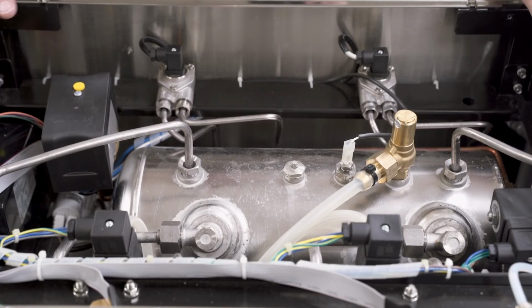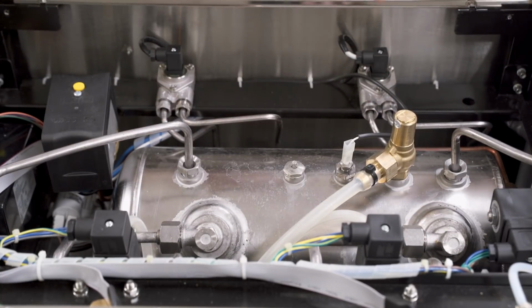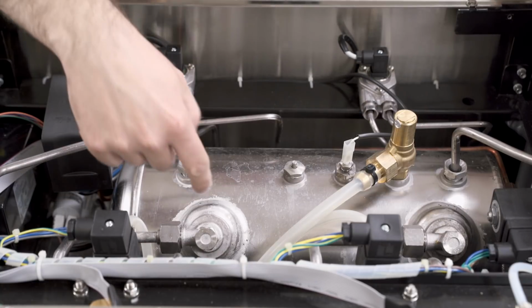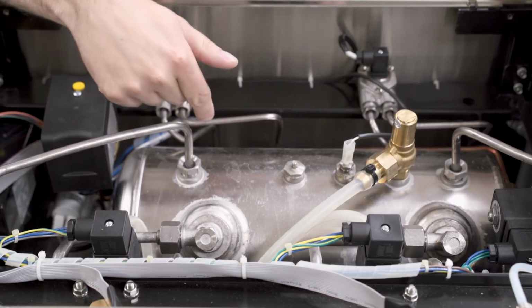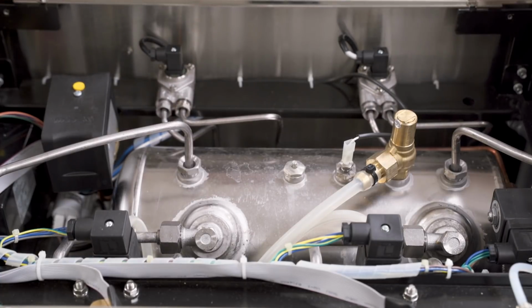We're looking at the inside of the Boxer right now. So this is the heat exchanger that we're looking at. There's just this big metal boiler in here. This one is coated, so it's actually a copper boiler, even though it might look at first glance like it's stainless. So this is copper. If you look at these two things right here, these are your heat exchangers. The angle that these are running makes me think that they run through the boiler like that, and the water's heating up as it's passing through.